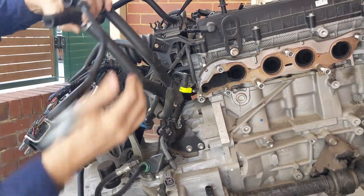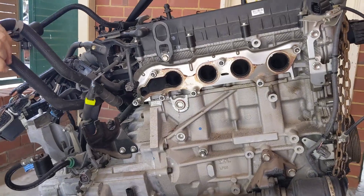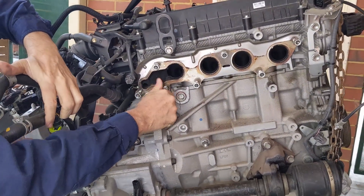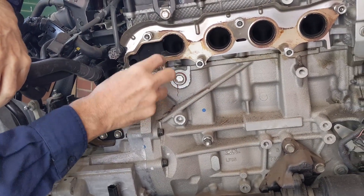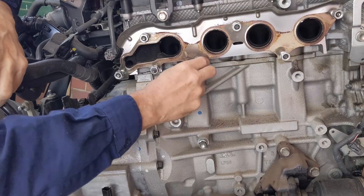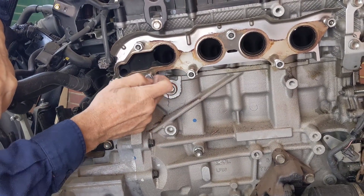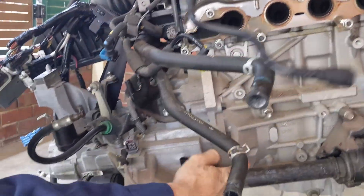Now on the left-hand side of the engine you've got the exhaust manifold here. These are 15mm nuts — I only took them off yesterday so it's very clear in my mind. You need a 15mm deep socket because a standard 15mm won't go far enough in to get over these studs. I've left the drive shafts in because I didn't want to drain the transmission fluid.